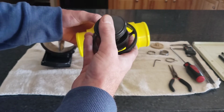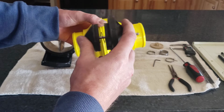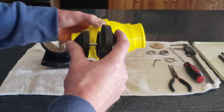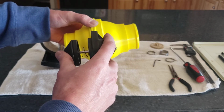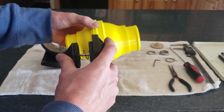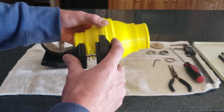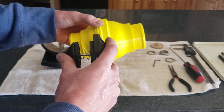And this setup is really great. It's a very simple valve, very reliable. The only challenge is that right now I can source valves that are built for very small engines, which is typically where these types of setups are used. And I need a much larger valve to support the airflow to my setup. Plus, my setup's at the very back of the car, and so again, any pressure drop or pressure loss that I can avoid would be great.